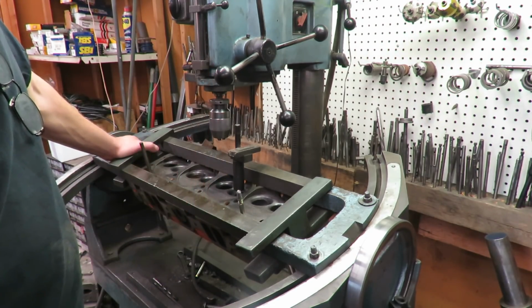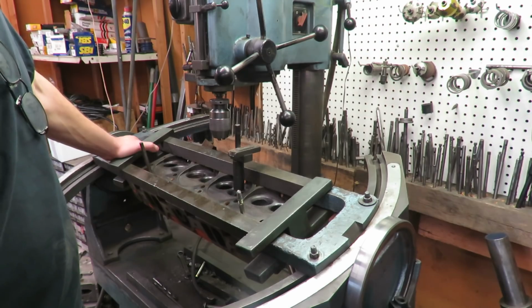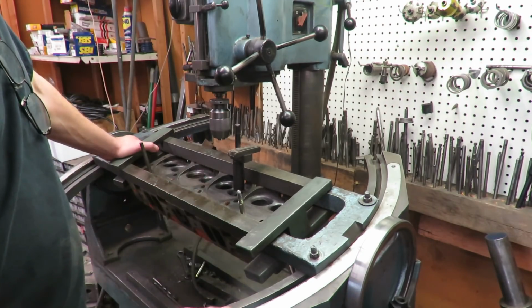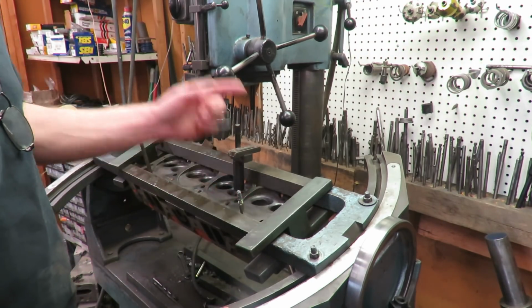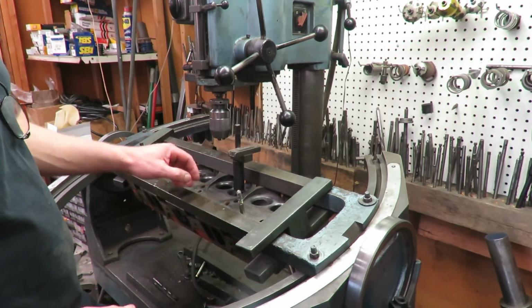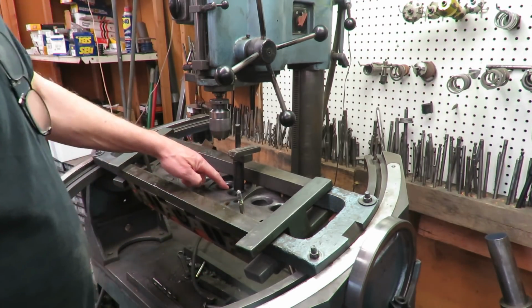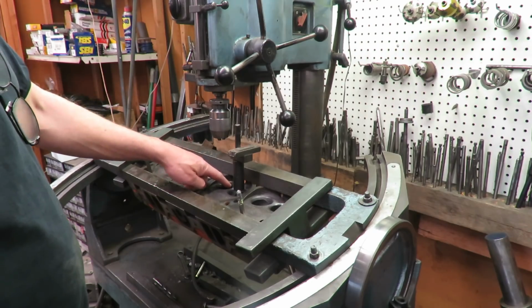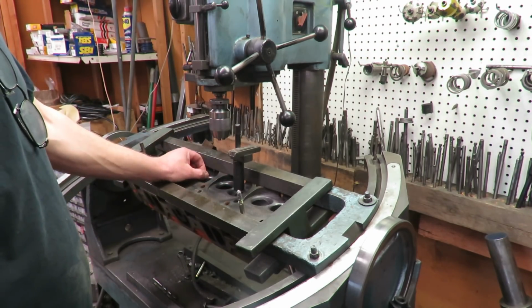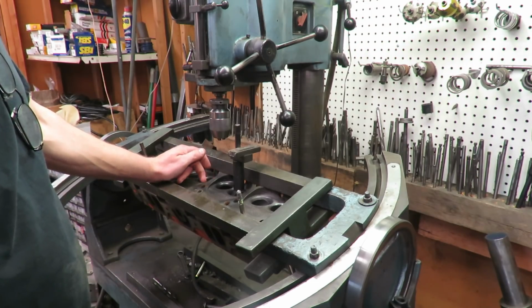It's not a 906 casting, but I've looked at the flow numbers and done some research, and these actually flow almost exactly the same as the 906, and they have the same size chamber. So it's basically the same head. The only difference is on the exhaust seats here, they induction hardened the seats. This was Chrysler's first attempt at making a cast iron head for unleaded fuel.